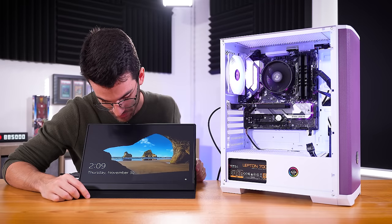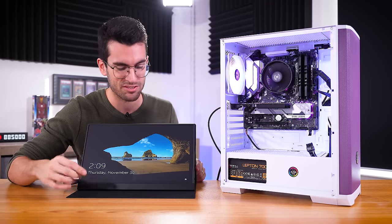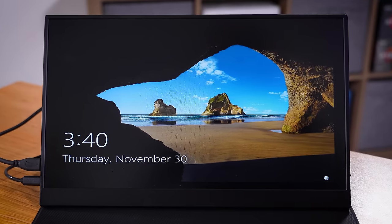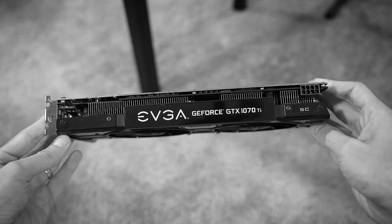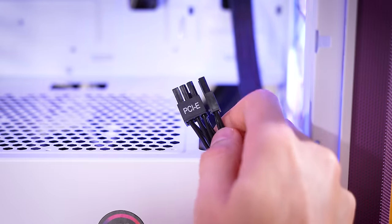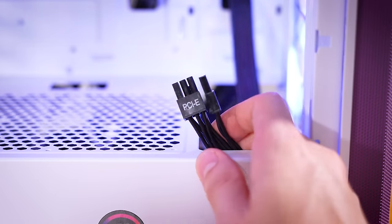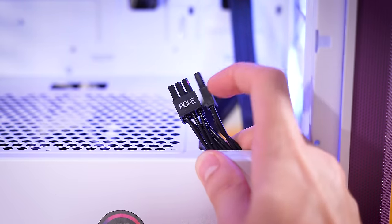In goes this tiny little thing — there we go. Would you look at that — boots up right away, first try without issue straight into Windows. Obviously we don't have the correct drivers for this card installed, but we're already much further than we were before. It's possible the GTX 1070 Ti is on its way out, but we can't jump too far ahead — this could still be a power delivery issue. If the card in question is not getting correct supplemental power, it would also exhibit the symptoms we were seeing.